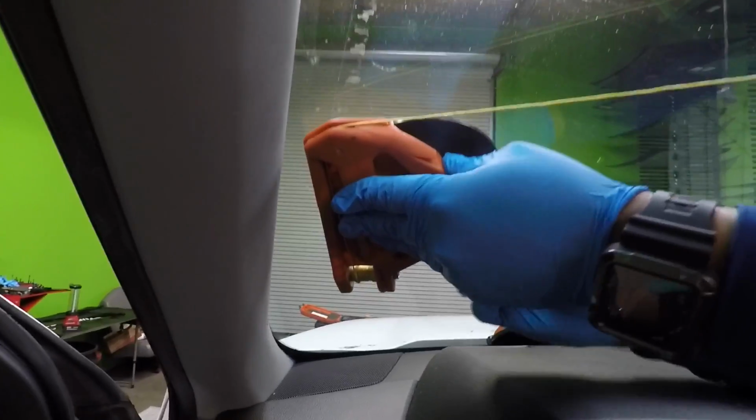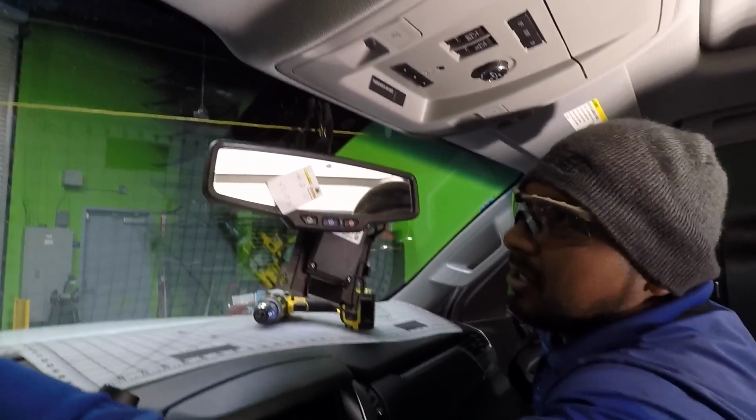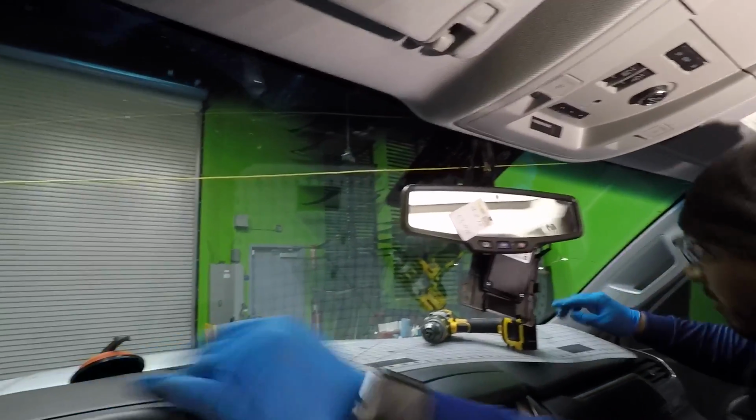here. This is an easy cutout, okay? So please know that I already done this cutout before, but my recommendation would be, if you have a top cutout that you never done before, you would put the tool one more time right here, cut from here to here, and then go all the way down over there.